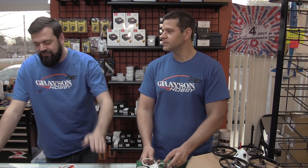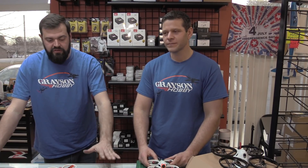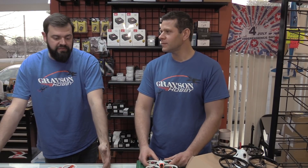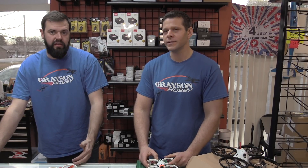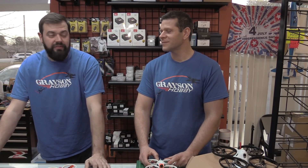If you are going to update the firmware and you just insist on doing it, please do that CLI dump, back up everything, make a file, and make sure you remember what firmware version you had prior. That way, if something screws up, you can always fall back. If you don't have that backup, you're going to be up the creek without a paddle.